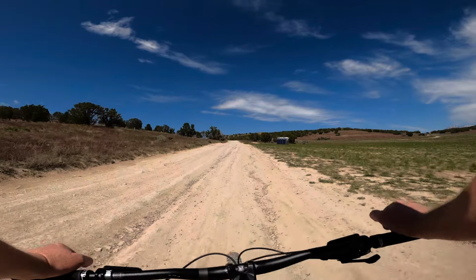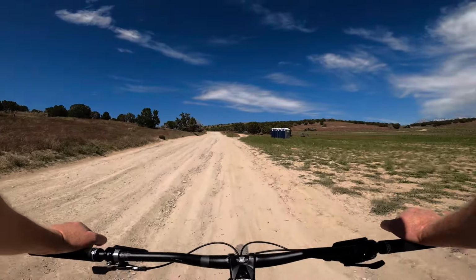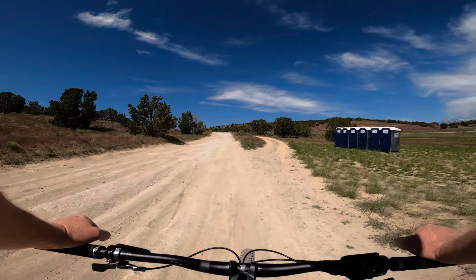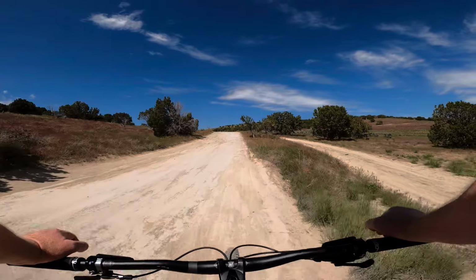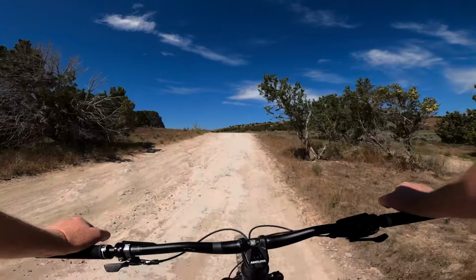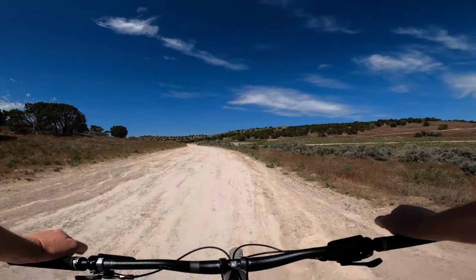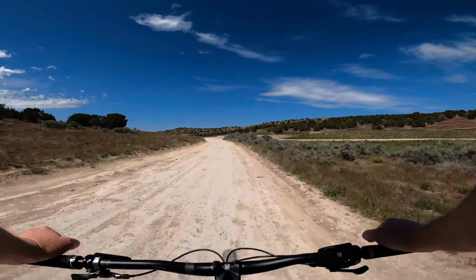The other thing I notice helping with climbing is that GX drivetrain that we swapped out versus the SX drivetrain that came with it. It had an SX derailleur, NX shifters, and that drivetrain's a lot heavier, but it also just doesn't shift as crisp. And I like this a lot better. It makes the bike just easier to get along with, get uphill. So this is a great choice if you're looking for something that climbs really well, stays glued to the ground on bumpy, technical stuff, and you just want a good trail bike that climbs super good but is super fun on the descents.